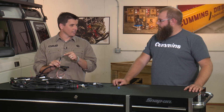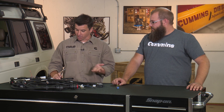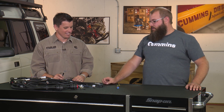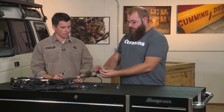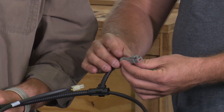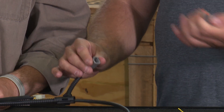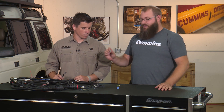So how do I get this to talk to my Cummins harness? Well, first thing you'll notice is this is a harness that many of you might be using on your builds. You look at that plug and it matches the plugs on our harness — it's gray and orange. Your first thought would be to plug it into this harness, but what that will do — if you look on our harness right behind where the Murphy gauge wire is — you'll find a plug much like this one. It looks like it's just a plug with nothing in it, so you might think you can unplug it, throw it away, and plug in your transmission harness. But you don't want to do that, because this is a terminating resistor for the CAN bus on our engine harness.